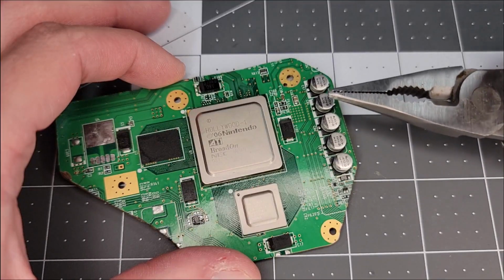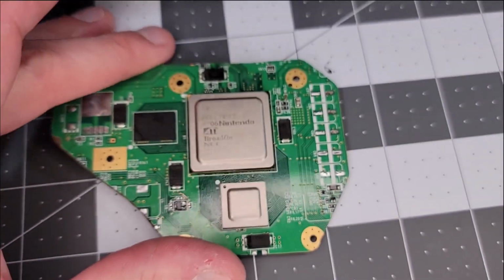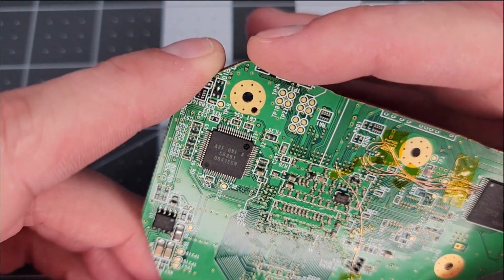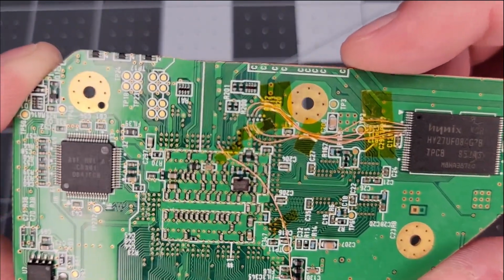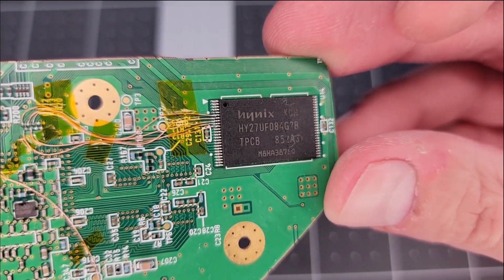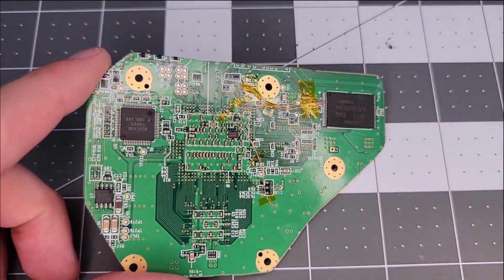Back to the Wii board, this capacitor column needs to be removed, so let's take care of that. Earlier I mentioned some concern about trimming too deep on one edge of the board, and this concern was valid, not because of these 3 chips, but because of the traces up here I cut through, which I've since re-established off camera in this wire grouping. Big thanks to Crazy Gadget on the BitBuilt forums for giving the advice I needed on this one, and pointing out that they are necessary for this build.